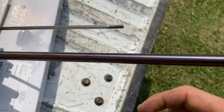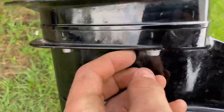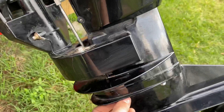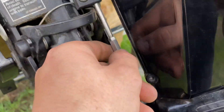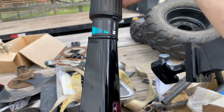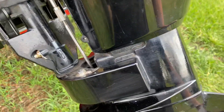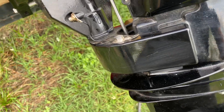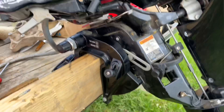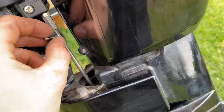You'll have to make sure these grooves line up at the end of the motor and make sure your shift shaft goes in the proper spot. I got the four bolts back in there. There is a torque sequence: one, then four, and then two and three are on the other side. Just follow that — snug them down pretty good, but don't over-tighten them; they're just going into aluminum. Then I just started the shaft back on just like before. Whenever you get that on there and get it snug, come up here and make sure you're in neutral and see how much slop is in there — you want it to be kind of in the middle. You can spin the prop too and make sure it's actually in neutral whenever the shifter says it's in neutral, otherwise it won't feel like it's going into gear right. Then just slide these back down, tighten that one up, and put the small one on the bottom.